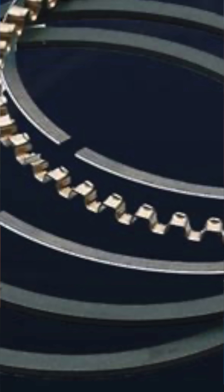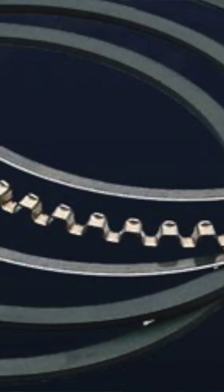What about the oil ring at the bottom? There are three-piece style oil rings, referred to as flex vents, and then you have the older cast iron styles. Most of what we do are going to be the three-piece flex vent style. Like you saw over there, we have that wavy expander bracelet-y part, and then you have the upper and lower scraper ring.